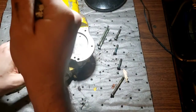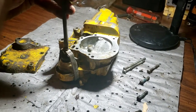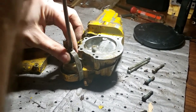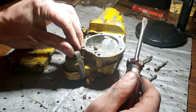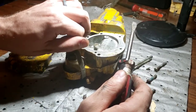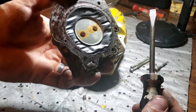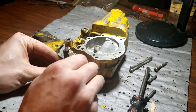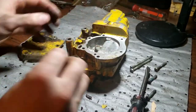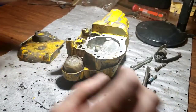Of course you can also see other marks too, but that could just be because you gotta clean out your sediment sometimes. Unfortunately, the kit does not come with this. It just came with a metering diaphragm. I had this kit made a couple years back before I was making my own, so we would be doing that right now, had not been for that. But nothing says now that we've got a good one, we can always have a backup. Not that I plan on using this saw every single day of my life. And that sediment bowl, I'm pretty sure if I pan what's inside of it, I will not find gold.